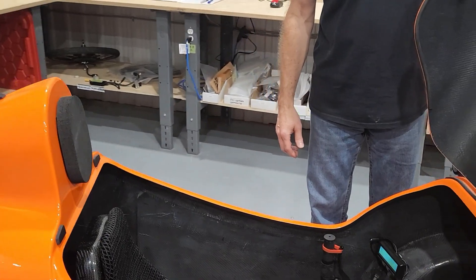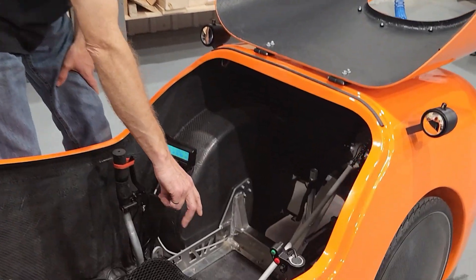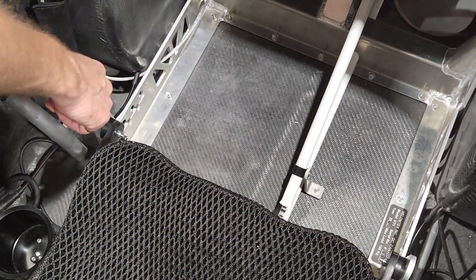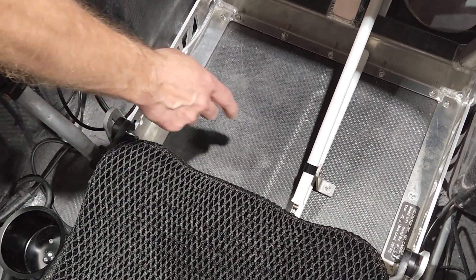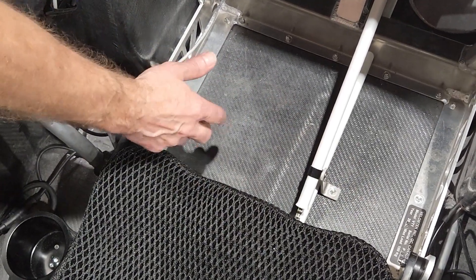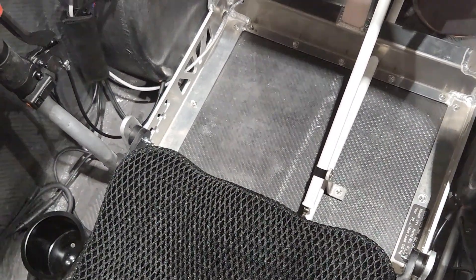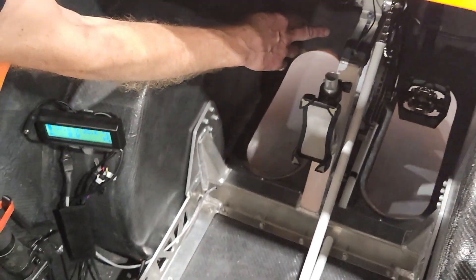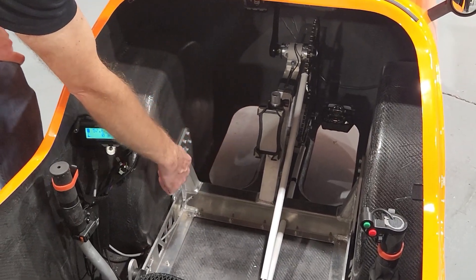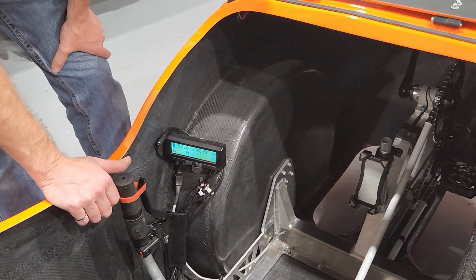On the front section for the attachment of the seat, we changed the way the aluminum plates are attached to the frame — you can now unscrew both sides from the inner side instead of the outer side of the frame, making the job easier. We also changed the way we route the cable for the torque sensor on the front, so this sensor cable is now routed inside the frame to prevent any damage.